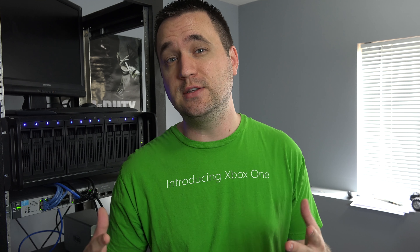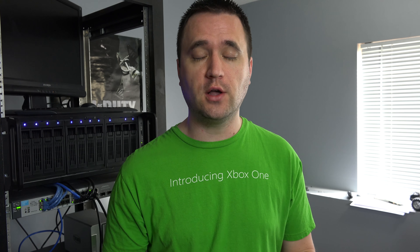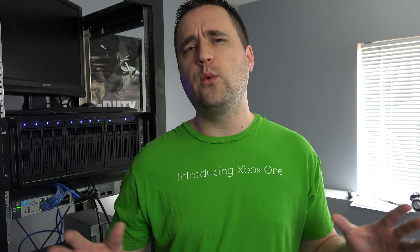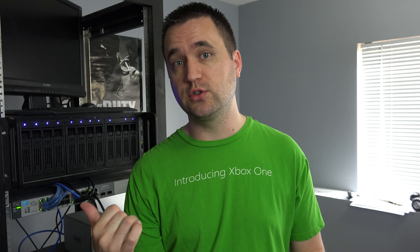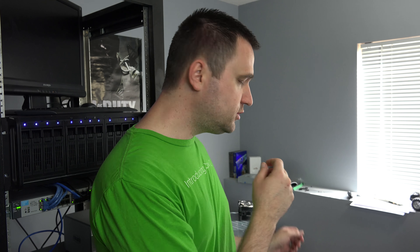What's up YouTube, Jason here with Bite My Bits. As you saw in the intro, that is my server as it stands — it is still super loud. I'll tell you what I've been doing to try to lower the sound overall. I went into my old boxes for the Noctua fans that I put into this server, and some of those boxes had PWM resistors inside that I didn't use, and I used those resistors on two of those fans which did help a little bit.